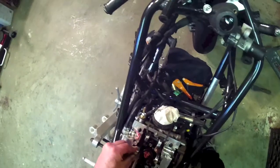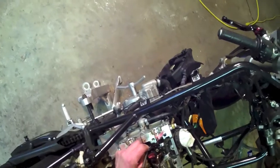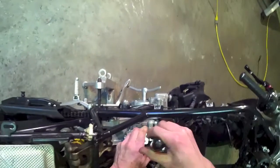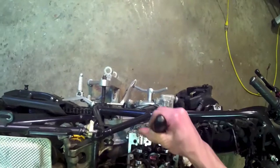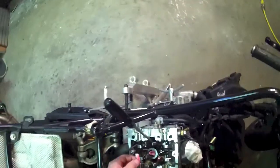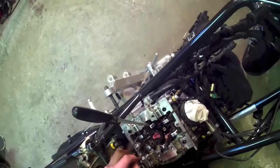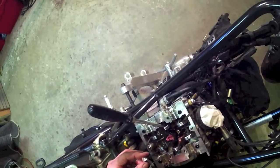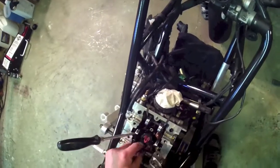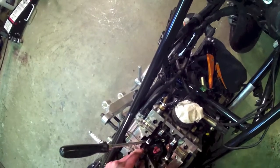My little workaround is to stick in a small piece of cotton cloth in the jaws, and that seems to be enough — with it snugged well down — to bite on the valve and provide enough grip so that the smooth, hard valve shaft isn't being compromised in its ability to grip against the tool.